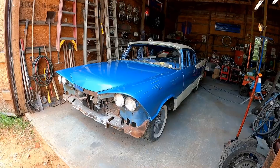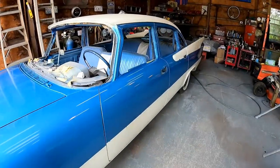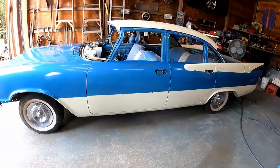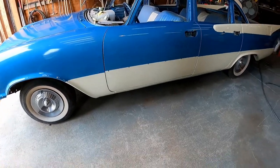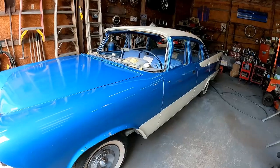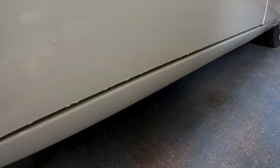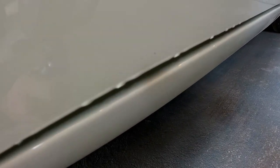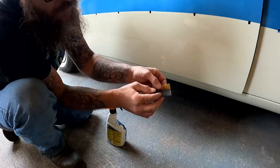Look at that — all the panels are finally on this car and she's looking sharp. I know some of you guys want to see trim go on, but I want to take care of something first. We do have some paint runs — hey man, it happens. In the paint shop we'd joke that any time you get a run or a drip, that's a painter's signature. I left my signature all over this one, especially down at the bottom of the doors. Listen, that is not a big deal — we can color sand those off and that's exactly what we're going to do right now.